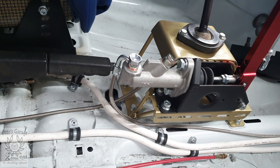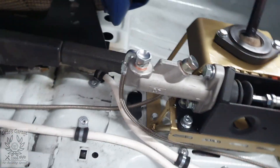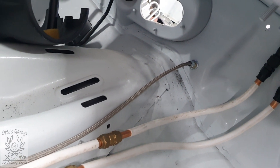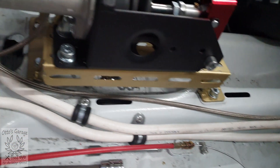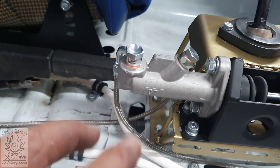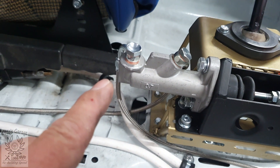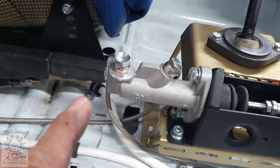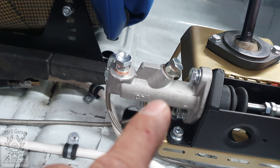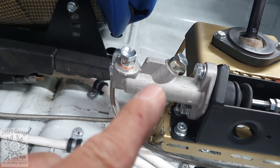Inside, we've fitted the brake lines onto the hydraulic handbrake. You can see the feed is coming from the bulkhead - we've got that bulkhead fitting which will ultimately go across to the master cylinder, and then that comes into the rear union. Some of the expensive master cylinders have them switched the other way around, but on these cheaper ones that doesn't necessarily mean they're rubbish - they're just cheaper. This one here is the inlet and the one at the front is the outlet.